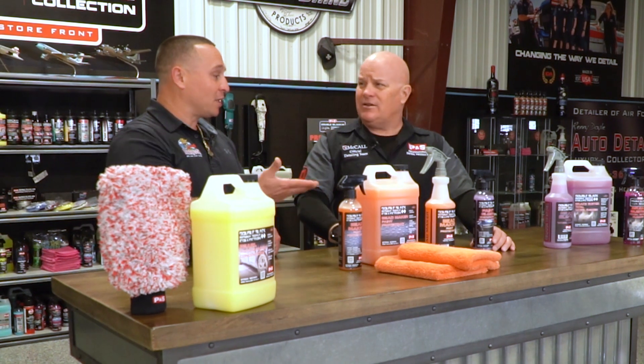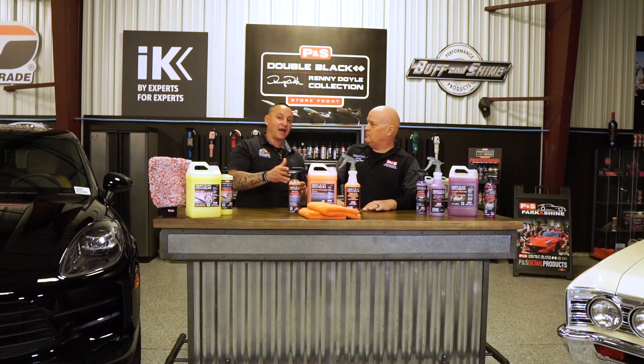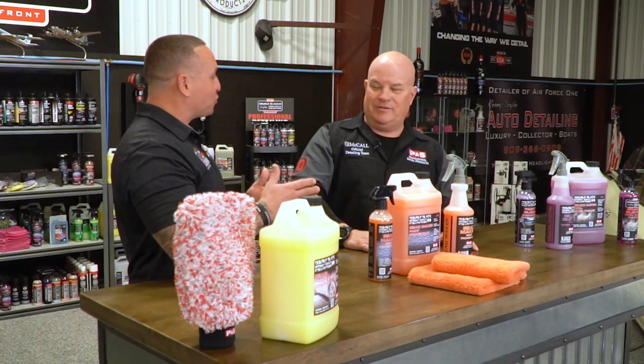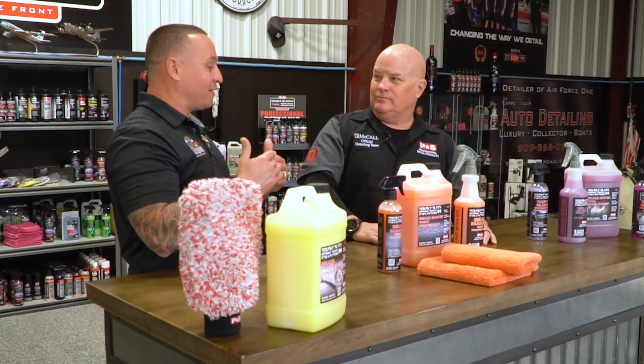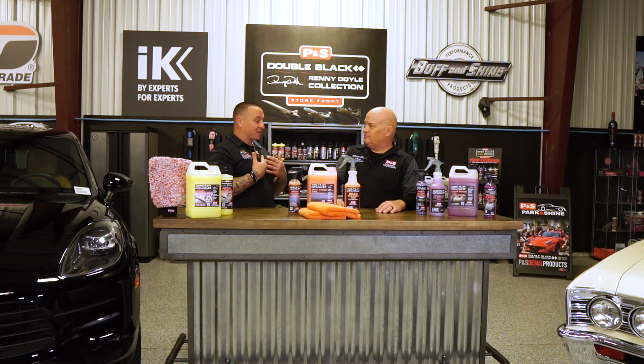Let's talk glass — your windshield. You preload this on the windshield and it gives that hydrophobic characteristic, like other products on the market, providing repellency in inclement weather. As an installer who does coatings in my shop, another huge key that people don't understand: if you preload Beadmaker on the glass after prepping the vehicle for coating, then if you accidentally bump the glass with your coating applicator, this helps reject the coating. It gives you a buffer of time to remove the coating while still giving the customer that repellency characteristic. Two birds, one stone — it helps the installer and the customer drives away with added value on their glass.